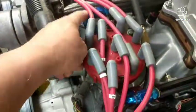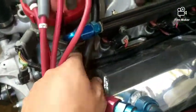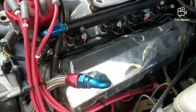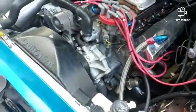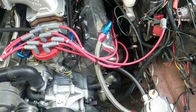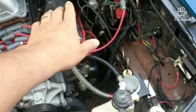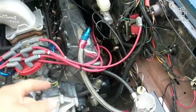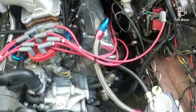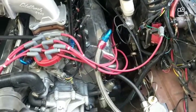Because of the fuel line up here, I'd normally have the engine coolant temperature sensor right there for the EFI, but since the gauge is down here I moved it to the back. When it picks up the temperature back there, I've got a 160-degree thermostat but it doesn't get over about 130-140 back there. I think the way the water is routed — coming from the radiator down through the bottom of the cylinders then up to the heads — that water isn't really hot back there, so the computer keeps thinking it's not warmed up yet and I have to keep messing with the tune so it doesn't burn up a bunch of fuel.